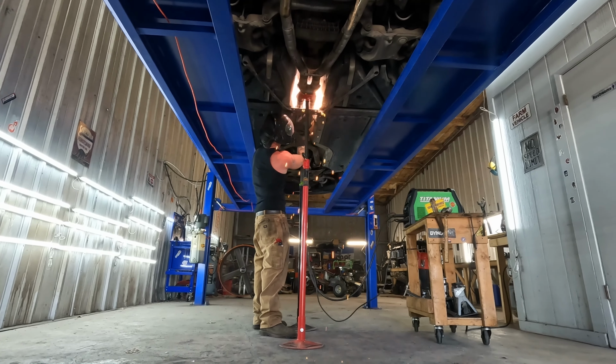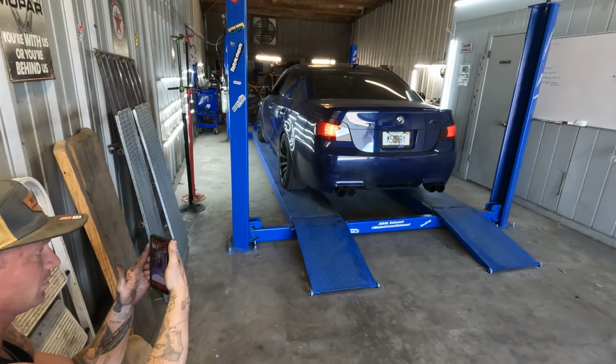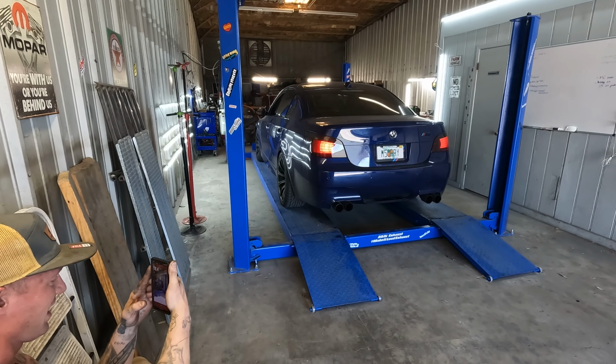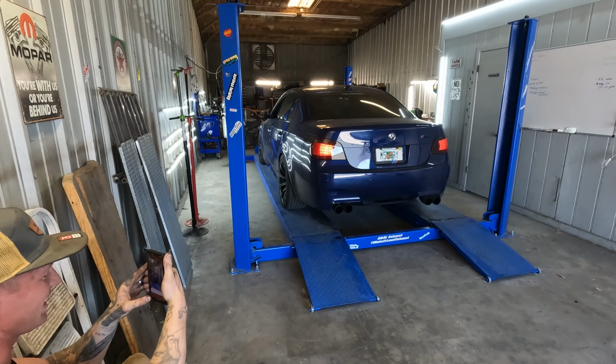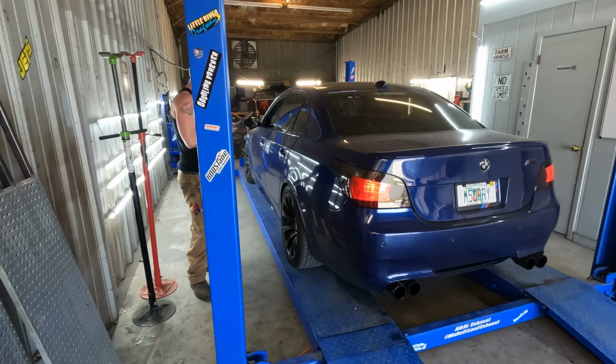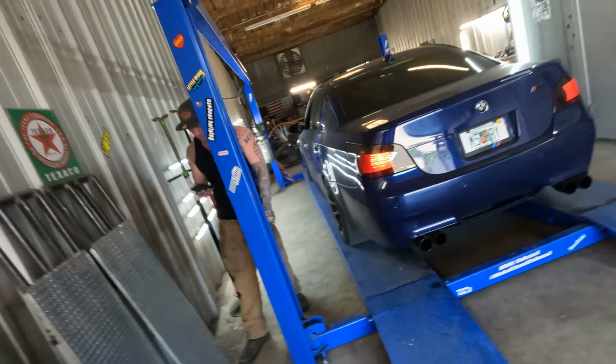All right, we're back in action. Looks like the idle is 7 decibels lower on average. I think they were idling between 85 and 89 before. Yeah. And if we shut up long enough, it settles down around 79, 82. Again. Sounds better. That sounds so much better. Sounds good. That was good. There we have it, guys. I think that's success. We'll have to do a couple flybys and do some in-car drivability sound comparisons, but I think we might have nailed it.